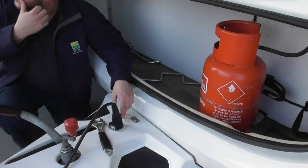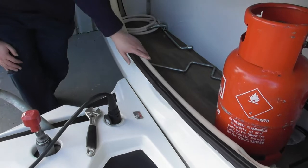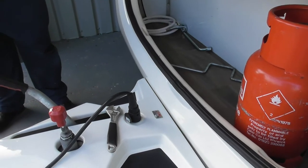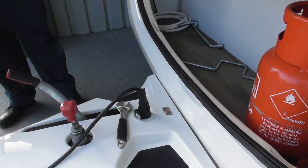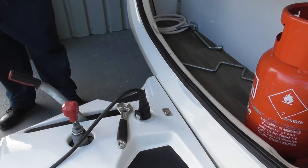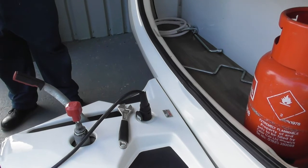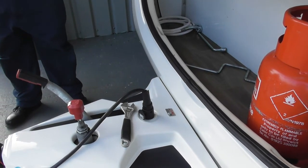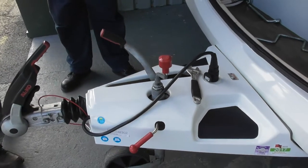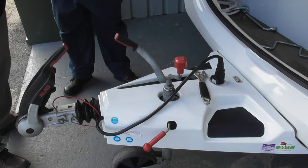Do you know about the red lights? If you've plugged it in and you keep getting a red light, first thing to try is just unplug it, leave it a few seconds, plug it back in. If that doesn't clear it, leave it plugged in but uncouple it off the car and see if the brakes are engaged. If the brakes aren't engaged you are safe to tow — it just means your ATC system isn't working. But if you go to move your van and the brakes are locked on, it's a definite no-tow. Don't be alarmed by it — I've only come across one person that's ever had any problems with it.